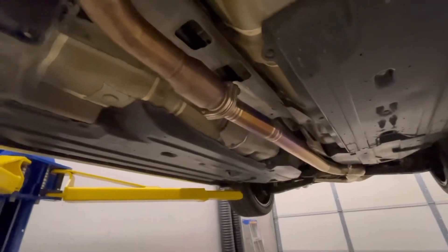The Perrin motor mounts — you can kind of see them right in there. They helped with the back-and-forth motion. You can see the other motor mount is right there as well. We were getting a lot of lash in the drivetrain, and loading it up out of second gear corners, it was just binding and releasing, binding and releasing — not a very comfortable feeling.